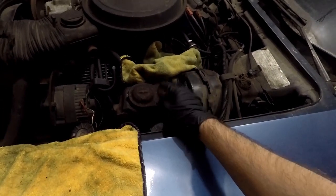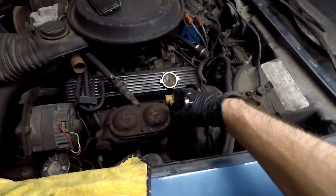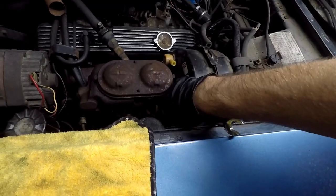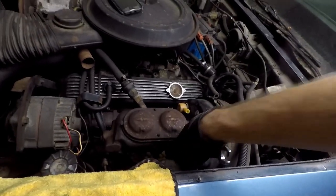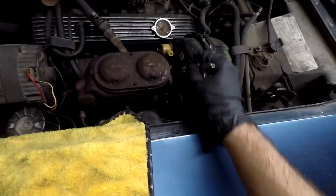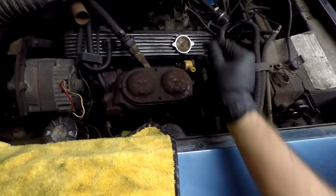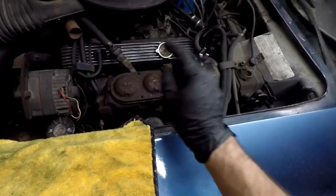So now I'm just gonna take the lines off the master and see if I can pull it out. I got the two bolts loose — the back one is already off. You need a wrench to get to them. It's some size between 9/16 and 5/8 — I don't know what size that is, I don't have it, but a 15mm metric wrench worked. It might have been 9/16 and then the rust just mushroomed it out a little bigger to a 15. I'm gonna take this off and put it on my table — and be careful you don't get any brake fluid on your paint.